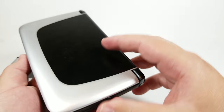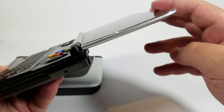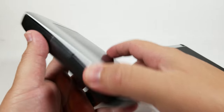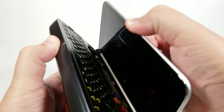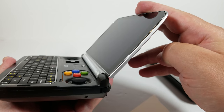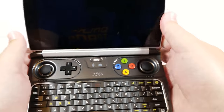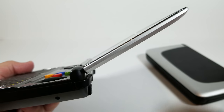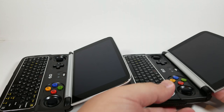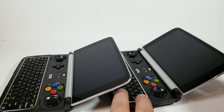There was one other change. This was a criticism of Linus — he didn't like that it defaulted to two different pivot positions on the screen. So GPD has opted to increase the tension of the hinge. There's a lot of tension to it, but you can see that there is no pivot until it gets to 180 degrees and then it locks. That is the only pivot point. Versus on my prototype it's almost impossible to get it in between positions because it wants to snap between both.